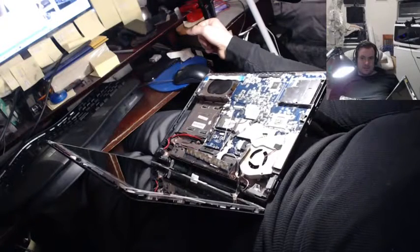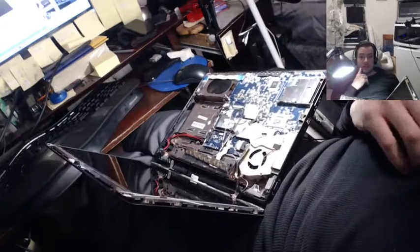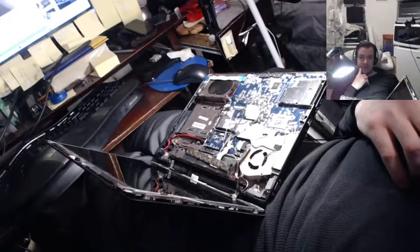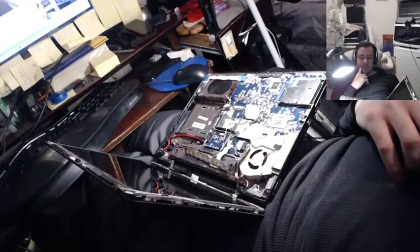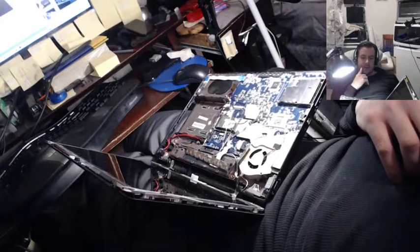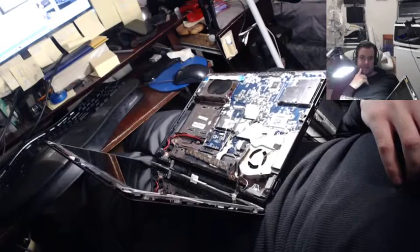So the overheating might have had multiple consequences, I'm not sure. But the computer certainly wasn't turning on, and then it just randomly started turning on again today. I didn't change anything, except cleaning everything out and replacing all the thermal paste, or thermal compound, that was on the processor. And cleaning out thoroughly the fan and all the heatsink fins.